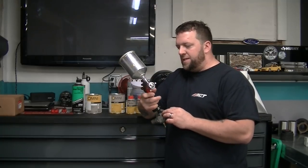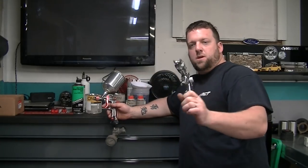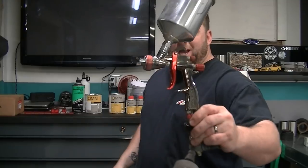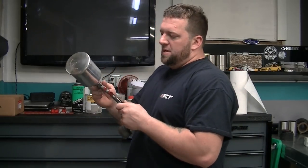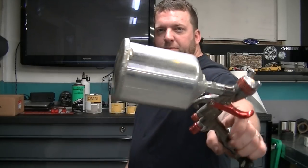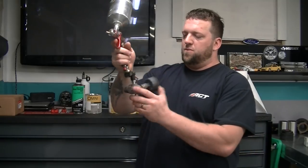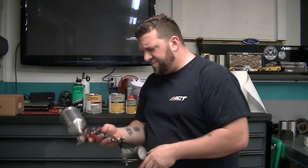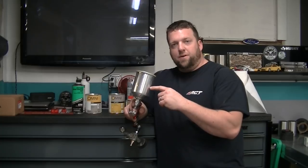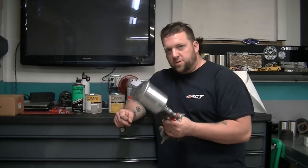A lot of you guys don't need to go super fancy. I've got cheap ones that don't even have names on them and they work. Now if you're painting a body you definitely want to get a better gun. This is a Mac Tools paint gun - it's got like a 2.0 tip in it. Painted a lot of stuff with this gun. You can still see the yellow on it from painting the inside of my Type R. I do have a regulator on the base of it because you want to regulate the pressure down. This is an HVLP - high volume low pressure - paint gun, which most guns are today. You want to regulate this thing down in the 20-something PSI range.